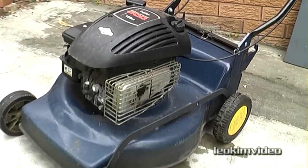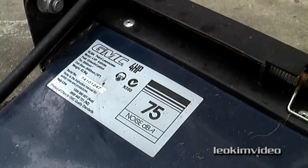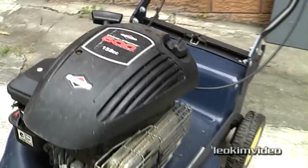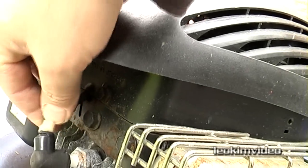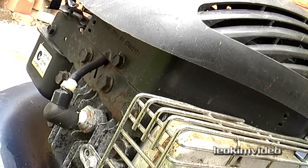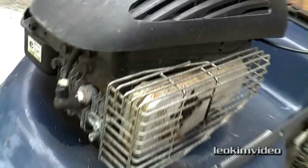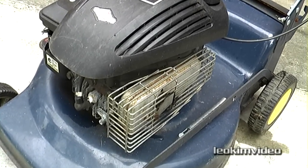This GMC lawnmower was quite good when I first bought it — I only bought it because it was extremely cheap. I did a few modifications to it so it doesn't need a catcher. GMC is interesting — it's made in China, and from what I believe it was designed in Australia. Unfortunately you can't get GMC stuff anymore. What was wrong with this mower was the coil failed. The coil is up inside there, and it's actually a coil I found on a lawnmower that was in the rubbish heap from another house. The coil was all rusty — it seemed like it was made up of components that had been laying around outside. And that was very early in its life — it was only a couple of months old and it had no spark.